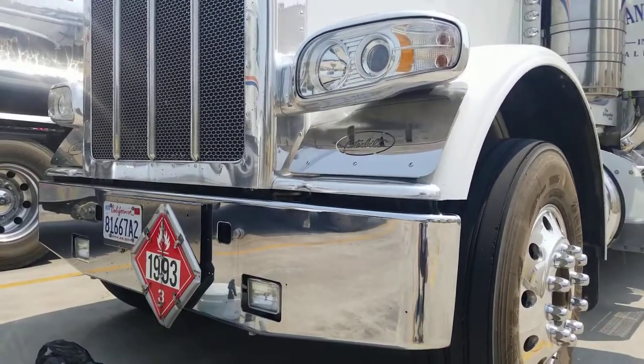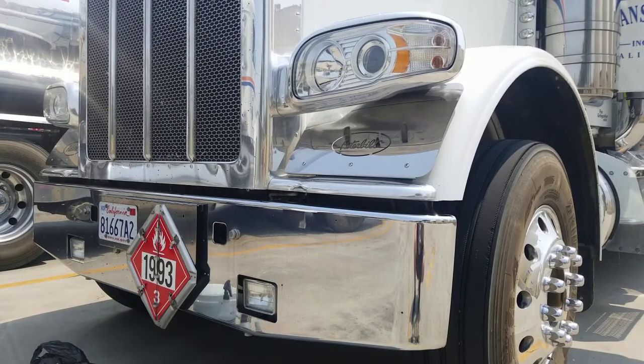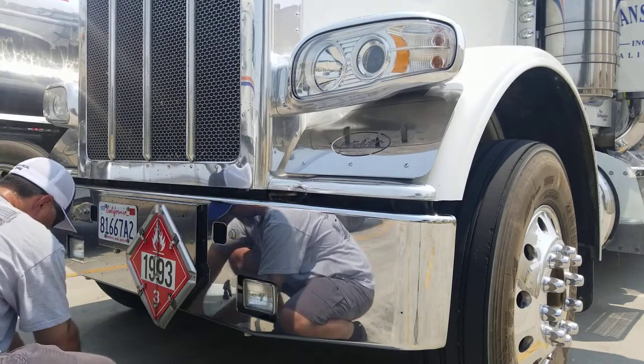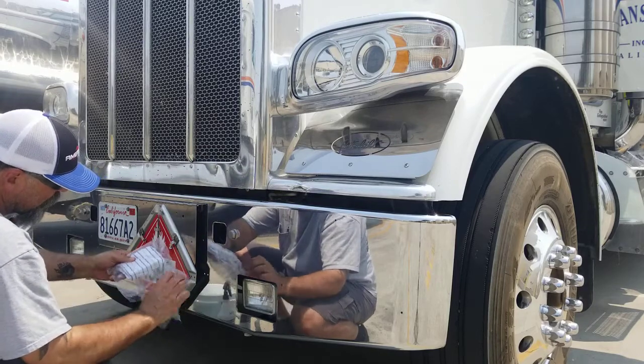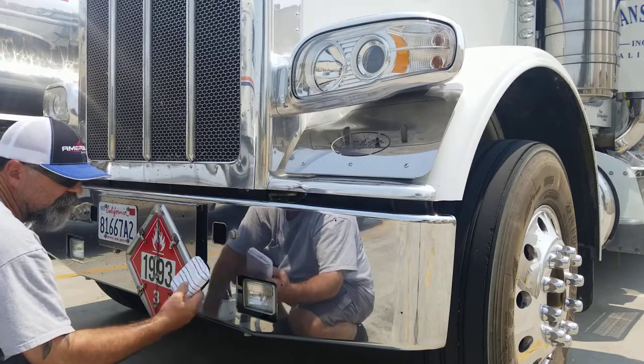It says to put a dime size on it. Now, what Aero has is a unique 4-2 system. So you put it on, let it dwell 4 minutes, level it, 3 to 4 minutes, level it, wait 2 more, buff it off. So this is my first attempt, and this is their advanced SiO2 wax ceramic coating, wipe on, wipe off. So let's just get with it, see what happens. Here we go. I brought a terry cloth applicator. These are cheap, like 90 cents a piece or something. So I figured if I use it and it's no good, I'll throw it out. No big deal.